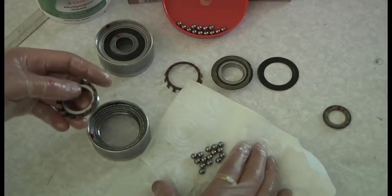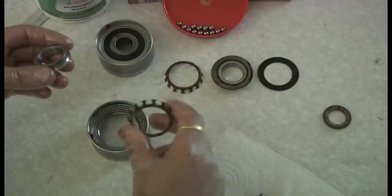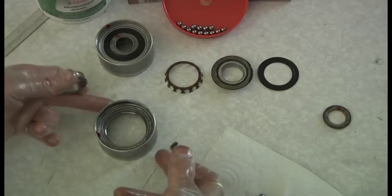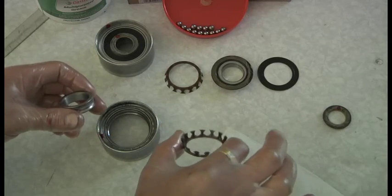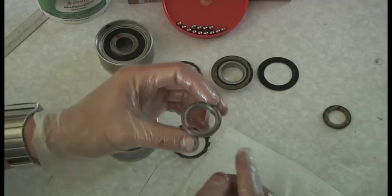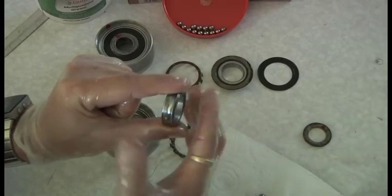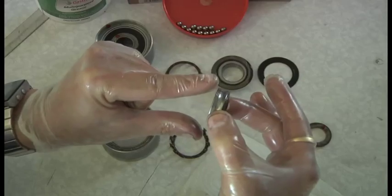Having done that, make sure all your pieces are clean. The way this goes together: this is the front, this piece faces forward so as you look at the tensioner bearing that's what you see - that's the front face, that's the back face on the table. The inner race points up at you like a crown. The piece that goes in the centre is tapered - tapered like my fingers, that way - so that you can press into the balls.